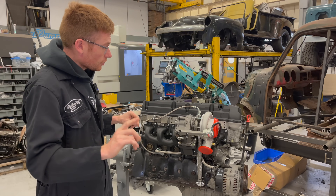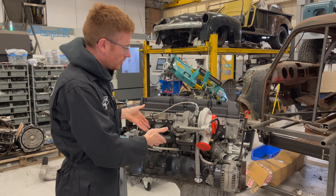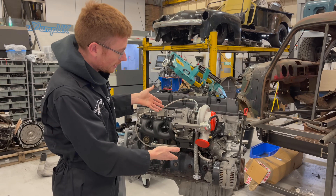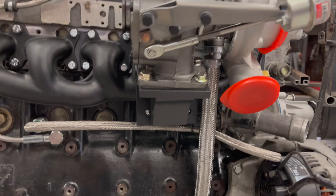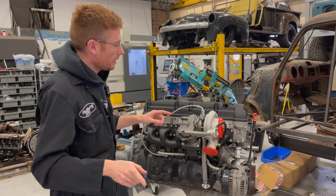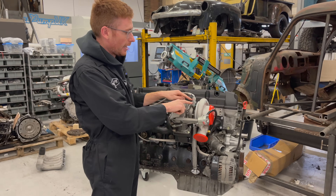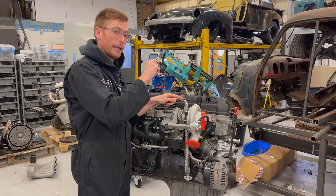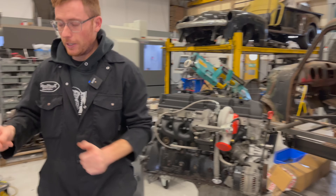What you're looking at here is the HX30 turbo kit on a customer's engine. It's not an engine we've built, but I've assembled a turbo and a pump on there for him, so I thought it's an ideal opportunity to show you this. It actually has our billet manifold adapter kit on it — this is only for a mild horsepower application. The HX30 uses a different inlet fitting to all the other Holsets; it has to have an adapter bolted onto the turbo for you to screw in the regular Holset feed, which is different. The return is the same as usual.